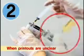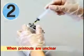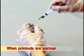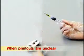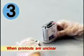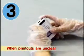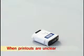Step 2: While pressing the black rubber plug with your thumb, pull the piston up to the 2 ml scale. Then pull out the syringe and release your thumb from the rubber plug. Step 3: After connecting the body with the cover of the cartridge, install the cartridge in the printer. Step 4: Run the cartridge cleaning process before use.